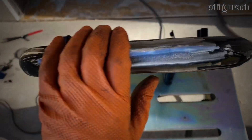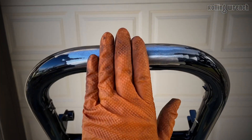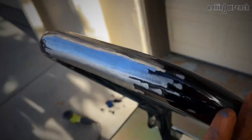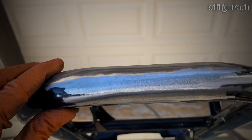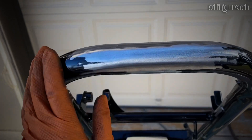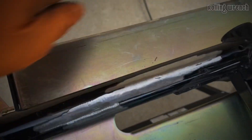Here it is - it's not completely smooth, a little wavy, but that's okay because I'm going to go over this whole frame with bondo and then paint it, so it'll all be perfect. That's probably about 90 percent. Then the last step would be to come in with some 100-grit sandpaper and smooth it out so you don't feel any lumpy lumps.